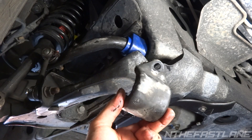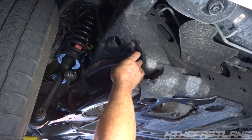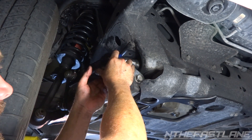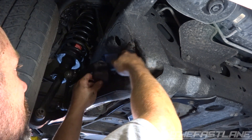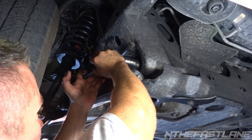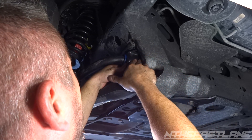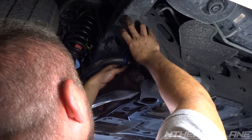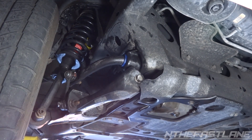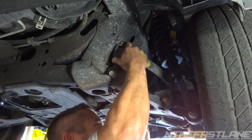I'm gonna go ahead and clean this bracket real quick on the inside. With the bracket cleaned up, pull this bushing back a little bit, get under it with the bracket, pull back as far as you need, slide it like that, and slide the whole unit forward. Get it into position and leave it like that — don't tighten it up yet because we still have to do the other side. If you tighten it up you won't be able to get the other bushing out.